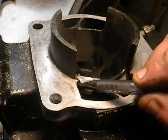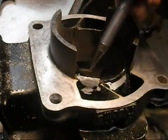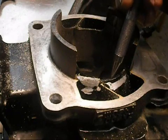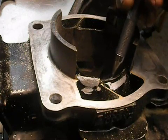Same thing here. They usually have a big — for lack of a better word, I'm going to call it a snot — right in this area. The radius here is terrible. Again, you have cast iron here, you have aluminum here. What you want to be careful of: don't run out. You can hit the cast iron to match it into the aluminum, but you don't want to run out too far to where you hit the end point of this.